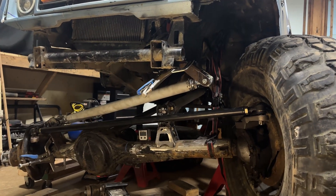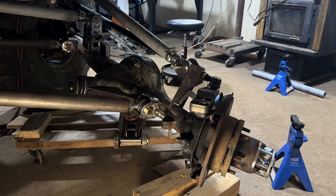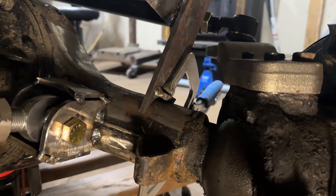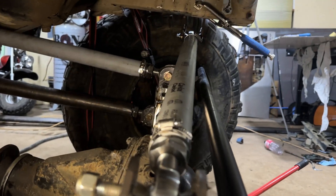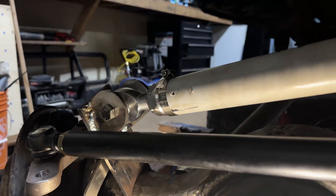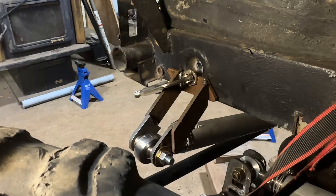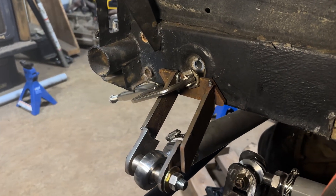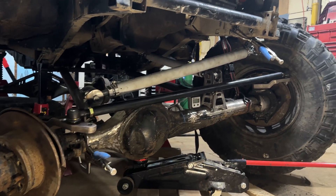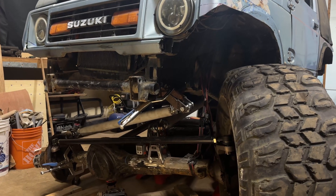My next task is a panhard bar. The main role of the panhard bar is to keep the axle centered under the vehicle and eliminate its lateral motion. Packaging the panhard bar is going to be a challenge, so I fabricated some mock brackets to help me understand where I may run into issues. I'm getting a lot of interferences with the tie rod as well as with the front axle differential housing. Ideally, the panhard bar has a close relationship to the geometry of your steering drag link — this helps eliminate the suspension from introducing undesired steering motion, commonly referred to as bump steer. This is a great start for me to begin designing the mounts in SolidWorks and run calculations from the location of the pivot points.